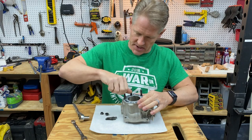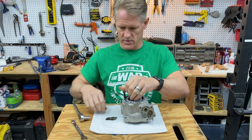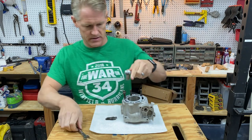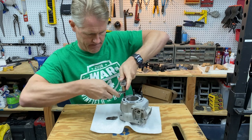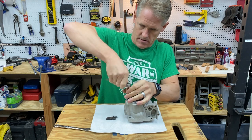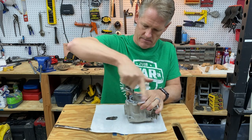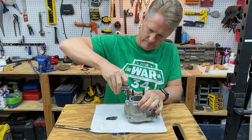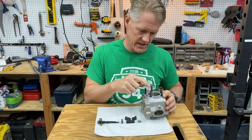The first thing I'm going to do is put the cylinder head studs in. The way you do that is you double-nut them — put one nut on backwards, upside down, one on the regular way, and tighten them against each other. Then you can run them down in. I've got all the head studs in.